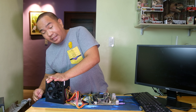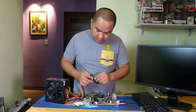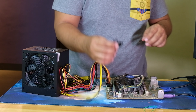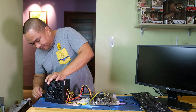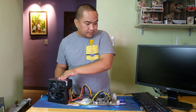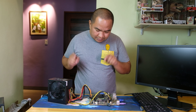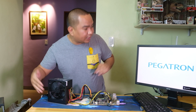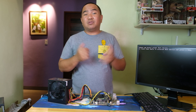Now we're going to remove the power cable so we can plug in the 24-pin and the 4-pin connectors to the motherboard. Then we connect the power supply and power it on — hopefully we will see a display on the screen. The fan is continuously spinning, the fan here is working, and there is actually a boot on the monitor! There is no hard disk connected so it won't boot to the OS, but fortunately we were able to boot the motherboard.